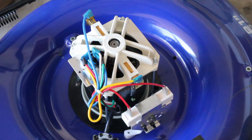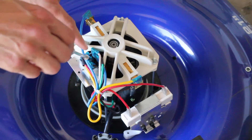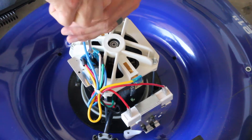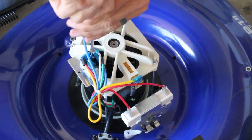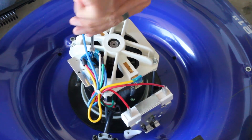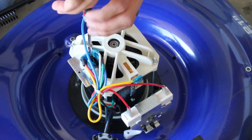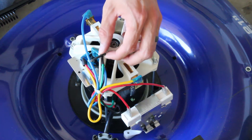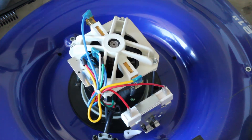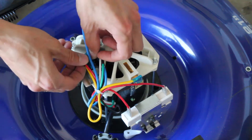Now there might be some roadblocks here as far as having the proper screws to get this undone. I've already taken a picture so I can get it back together with the correct wires and the correct posts. That's coming out fairly easily. There's what the screw looks like — it almost looks like a wood screw. And the rectifier comes right off; I'll pull these wires.